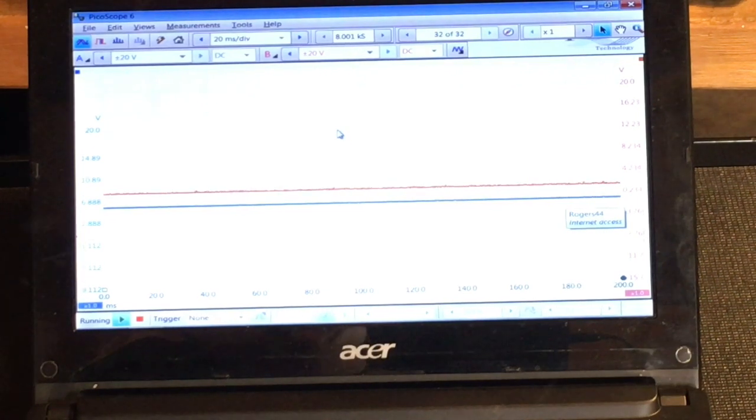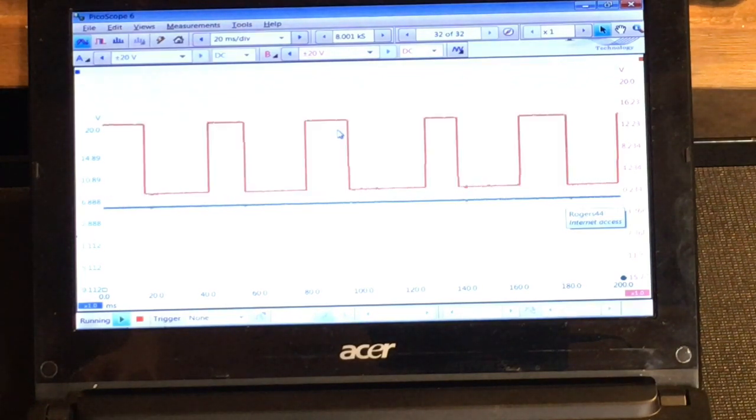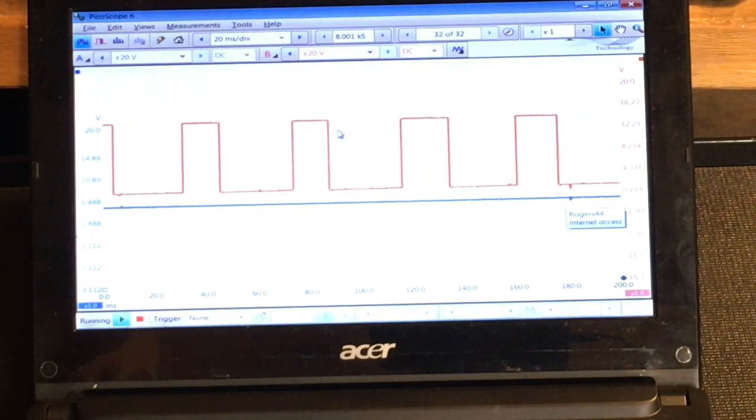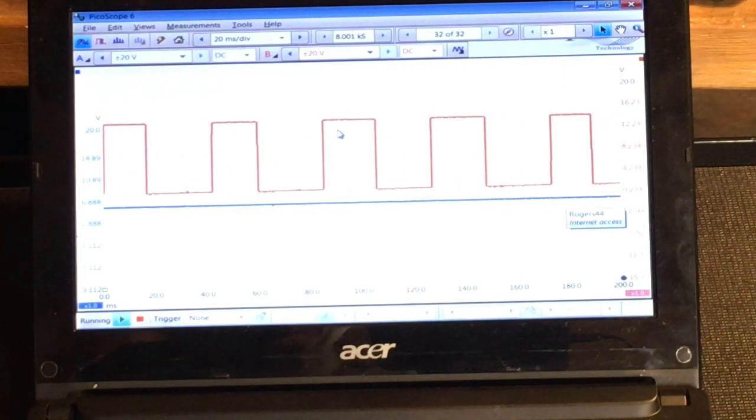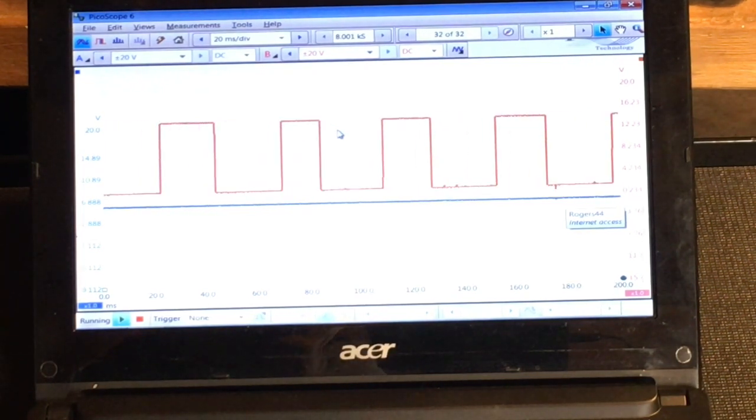So everything is loaded up, boys. The high beams are on, the rear defrost is on, the blower is on yet again. It looks from the feedback line like we're maxed out, and the request is gone from the ECU. So I'm just going to drop the load and we should see a change at least on the feedback line, I would think. So there you go. I don't know what to tell you, boys.